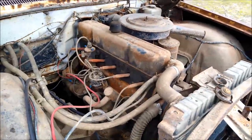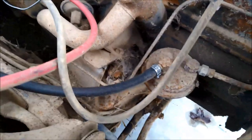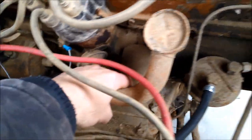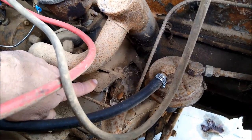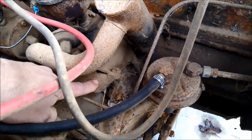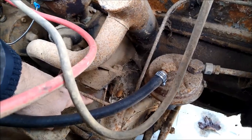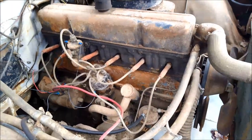I'm going to leave this 6-cylinder in here and try to drive it with this for a short amount of time. I've got to get me some of the short frame mounts. They're made like triangles. And I talked to my dad, he may have some. The upper mount, well, part of the upper mount. So there's this metal bracket here that bolts to the 6-cylinder engine with 3 bolts, the typical old school Chevy rubber motor mount, the kind that break on you if you got any kind of torque. These should bolt straight to the small block. And then I got to get the shorter version of these. I saw online a guy said he used to try to run with the 6-cylinder tall mounts, and it puts your engine on like a 20-degree angle and throws off your pinion angle with your drive shaft and caused him all kinds of trouble.